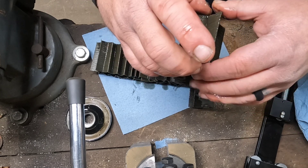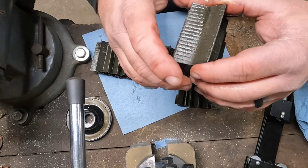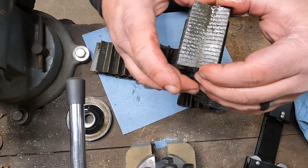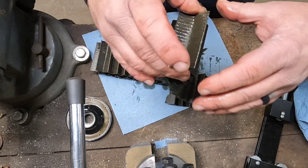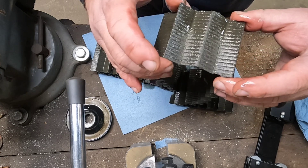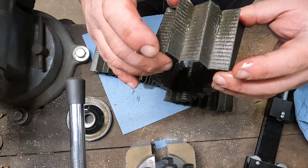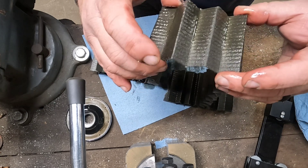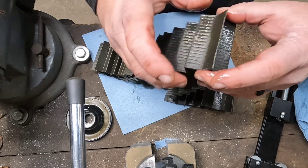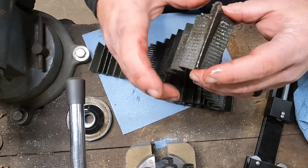I don't have an oil filter bypass — I've got an aftermarket billet filter adapter, so it won't bypass the filter. It always will have filtered oil going through the engine. Yeah, we're looking good. I don't see anything bad in here. There are a few little things here and there, but nothing that looks like bearing material. And it doesn't look like a 70s sparkly boat paint job.